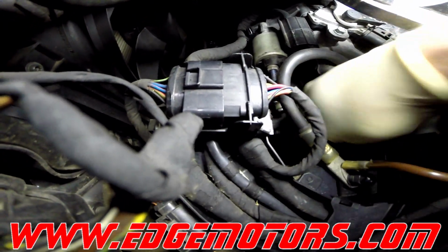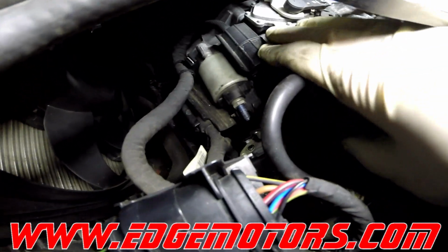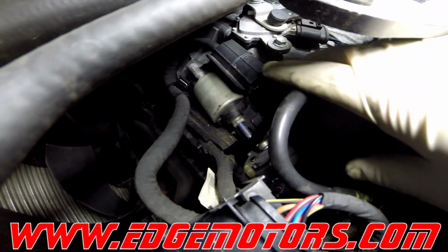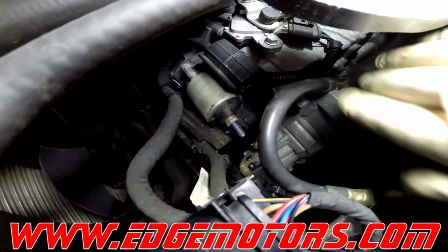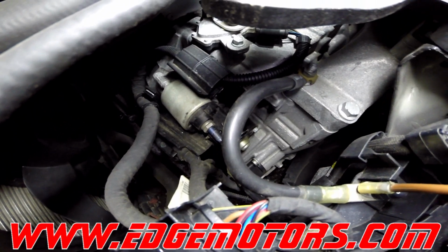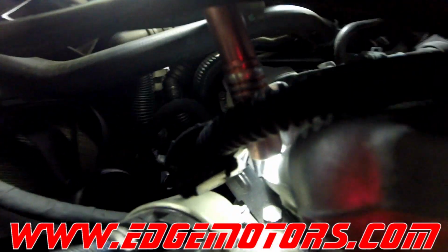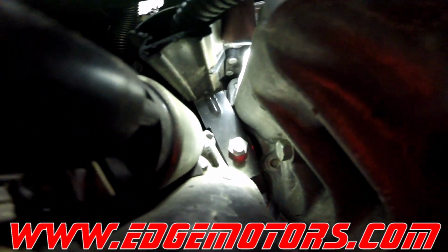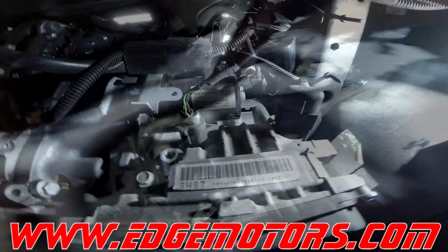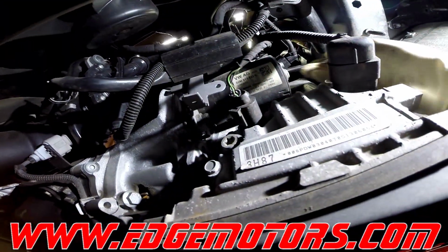Alright, so our wires are disconnected. Now we have this little wire harness bracket. It's held down by a 13 millimeter nut to the starter bolt. You're gonna need to grab a little extension and get that nut off. See, here's that 13 millimeter nut I'm talking about. It may be easier for you to do it from the bottom of the car.